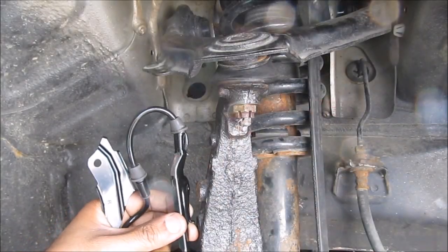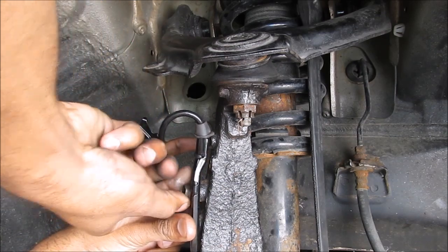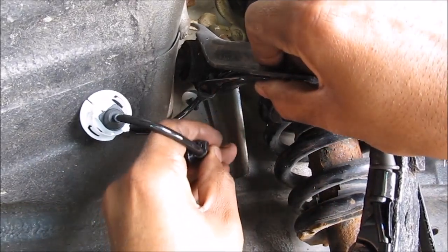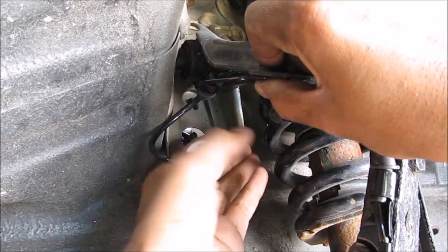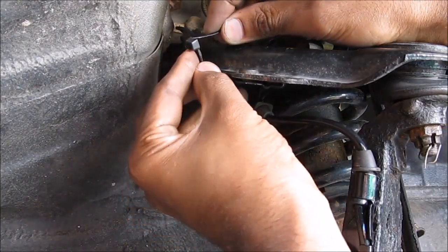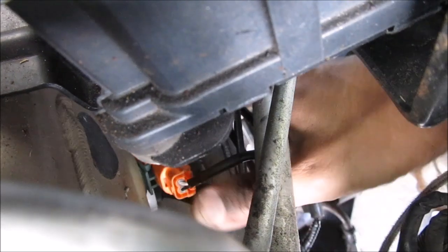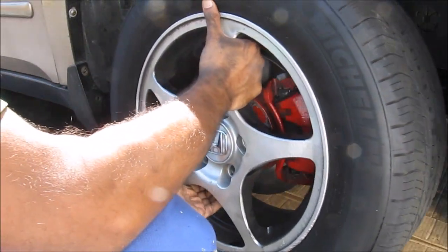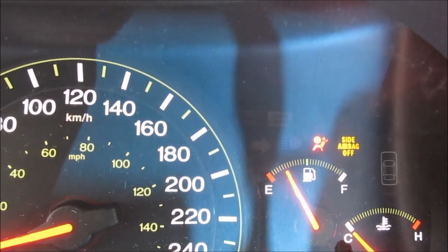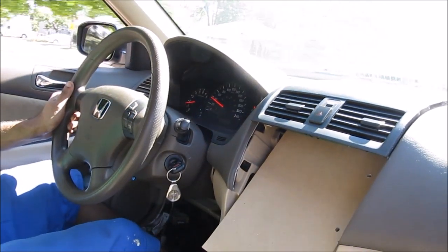Next I'm going to run my new ABS sensor wire over to the top of the steering knuckle and replace the 10mm bolt. Once the bracket is attached to the upper control arm, we can feed the wire through the wheel well and into the body of the car, then click the white bushing in. Because I broke the bolt, I'm just going to run a zip tie around the upper control arm to hold the ABS line in. I'm going to reinstall the new sensor connector — make sure it clicks. Finally, we're going to replace the wheel. When I turn the car on, you can see the ABS light goes out. Finally, I'm going to take the vehicle for a test drive and make sure the ABS engages properly over a slippery surface.